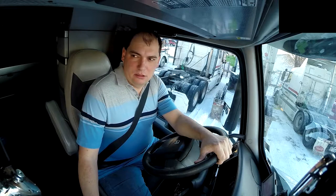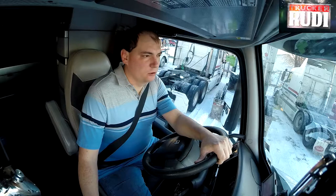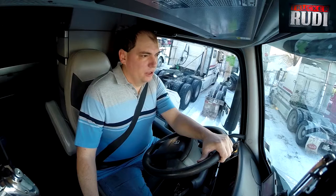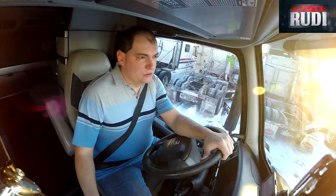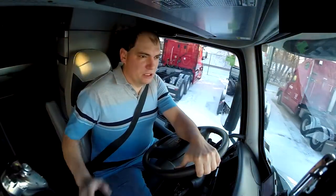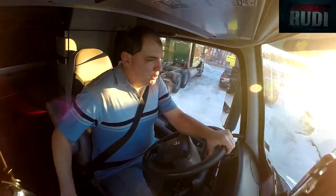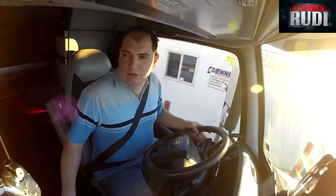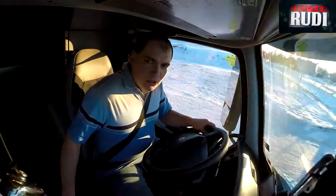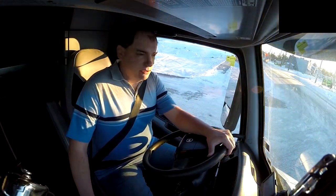And mine wasn't. I tried once — wasn't. Tried a second time — wasn't. So I went and pulled all the way forward and looked to make sure the fifth wheel was actually open. And it was. So I backed her underneath there with a little bit more force, and then she locked in. I went and grabbed me a flashlight. Went and looked to make sure it's locked in. Then I did another tug test to make sure that it was good, and it was good this time.